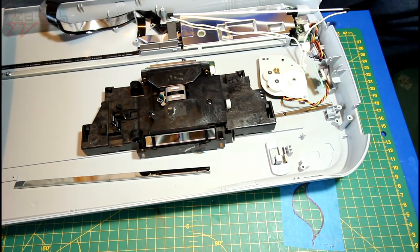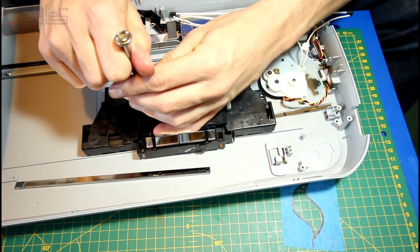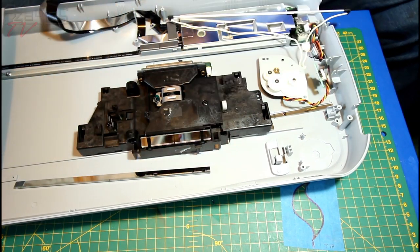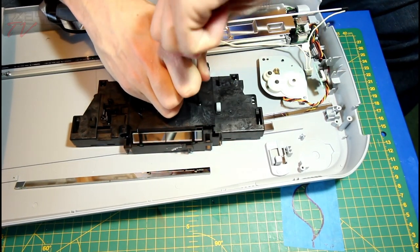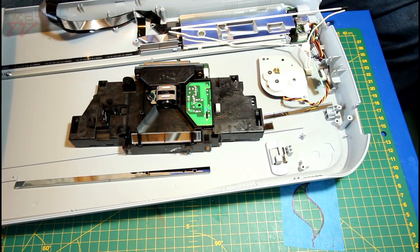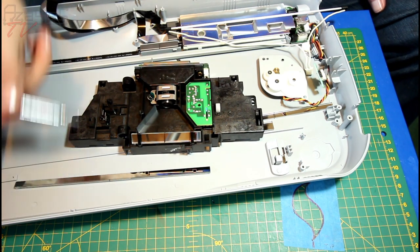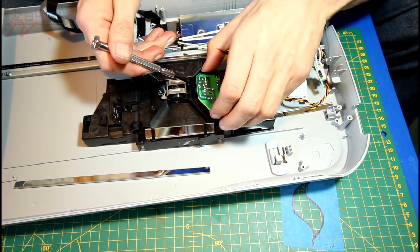Cover off of this. Yeah, this is definitely not your average scanner, which is why I got this one for teardown, because I thought it's quite old. And it's got quite a lot of stuff in it that nowadays is pretty obsolete. And it's quite over-engineered. As I say, nowadays you'll have just a simple sensor strip running the entire width of the area to be scanned, and an LED bulb. It'll actually be one LED right at the end, and then a reflective strip that carries that light all the way down to the other end. But this is something completely different.